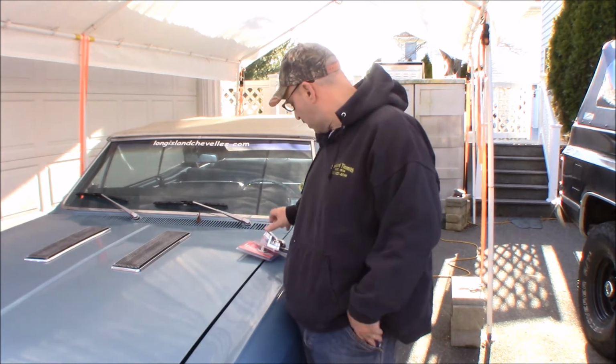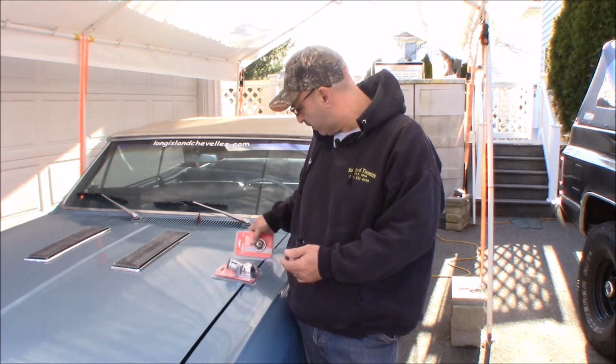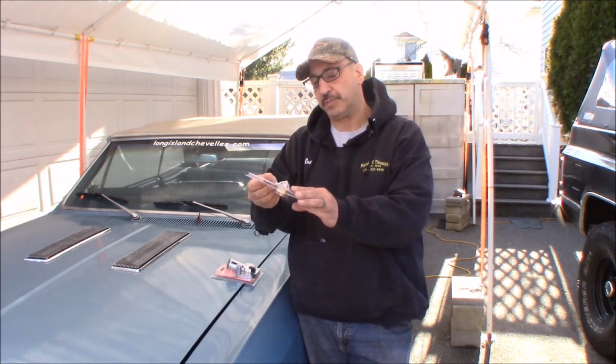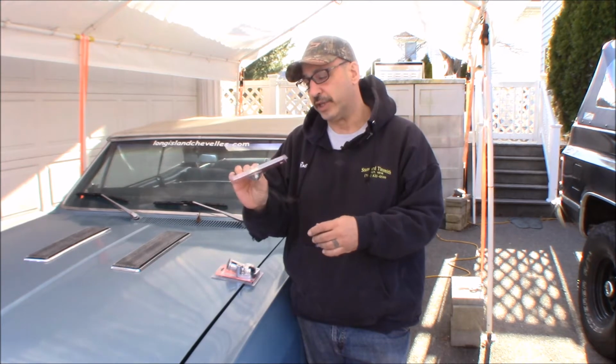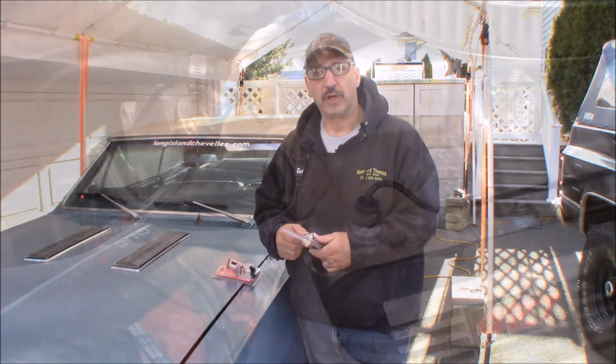and it's got a little tiny hole in it. So what we're gonna do is we're gonna pull the thermostat off, we're gonna pull the housing off, clean it all up, put a new thermostat housing on. I got a new water neck, and we are gonna put in what's supposed to be a high flow 180 degree thermostat. We did try a 160, and a 160 was still making us run too cool on a cool night or a cool fall or spring day. So we're gonna go back with the 180. We're gonna go with this higher flow thermostat and see if it makes any difference. If it doesn't, I guess we'll be trying to find a water pump that'll flow a little bit more at idle. But let me get the hood open, get some tools out, and we'll get started.